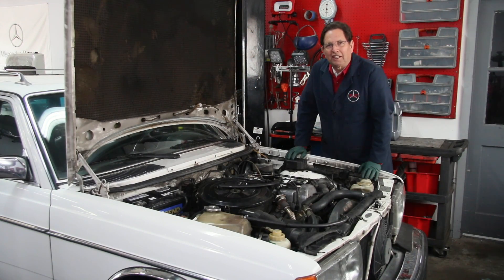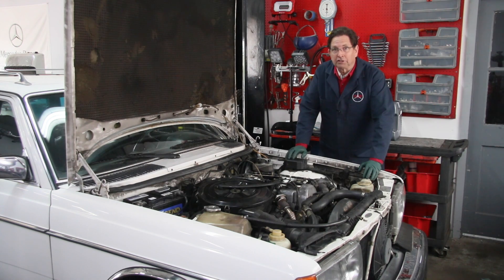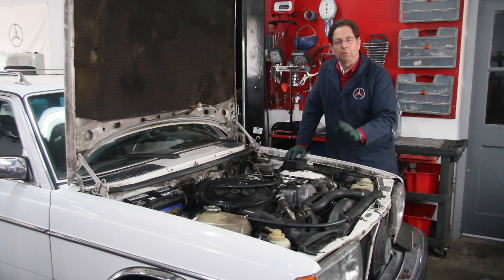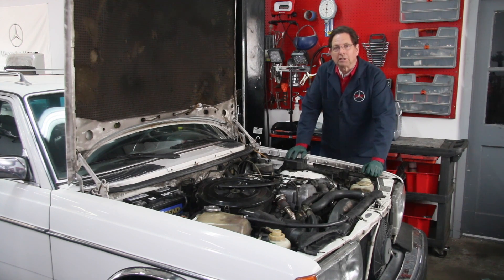The problem's not solved yet. I've got this diesel wagon back in my shop chasing this smoking problem, and there are still a number of things I could check. I've got to determine whether or not the injection pump timing is correct. The engine was overhauled, but the pump wasn't rebuilt, the turbocharger wasn't rebuilt, and the injectors weren't rebuilt. I redid the fuel injectors, but it didn't make a whole lot of improvement in the smoking problem, so this has me really concerned.